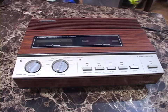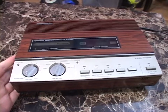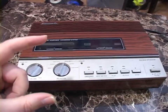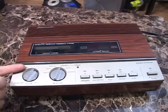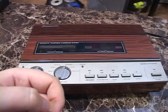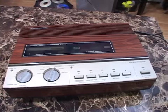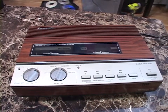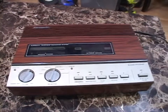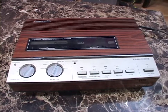The base model was the KXT-1510. Then there was this unit, the KXT-1520, which added remote control capability — the machine came with a little remote. When you went away from home, you could call home, press buttons on the remote, hold it up to the telephone receiver, and the controller would make bleeping sounds the machine could understand, so you could listen to your messages remotely. Then there was the KXT-1525 and KXT-1530, which added more features still. Even though it is computer controlled, it is primitive in a lot of ways, which we'll explore throughout this video.